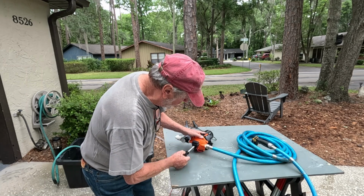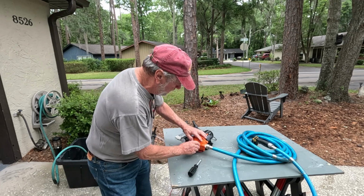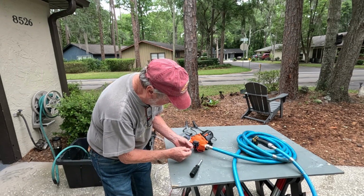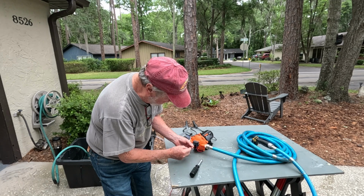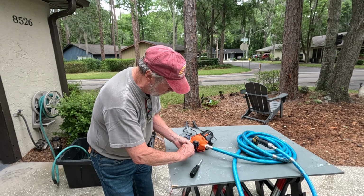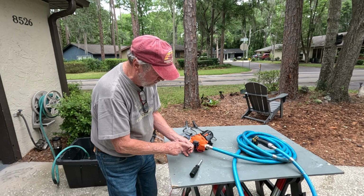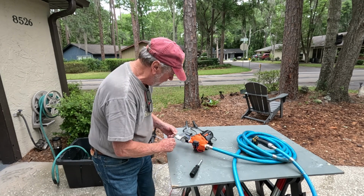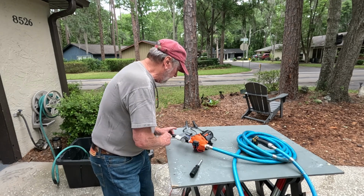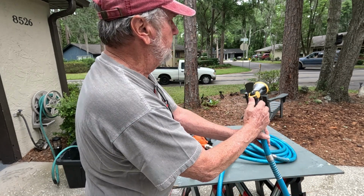I did a quarter of a turn of the pressure switch here counterclockwise to lower it. So I take this off, put my wrench in here. I started at 12 o'clock. I'm at 9 o'clock. I'm going to go on down another quarter of a turn down to this point. So if I want to bring it back to where I was, I'd have this straight up, okay? And I don't need to cover that right now until I'm completed, but that's the pressure switch right there. Now we're going to turn it on and see what we get.